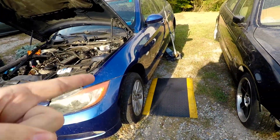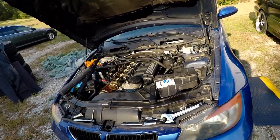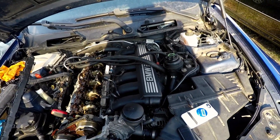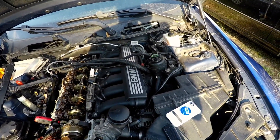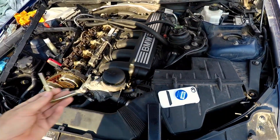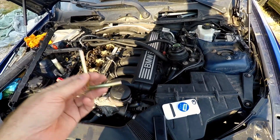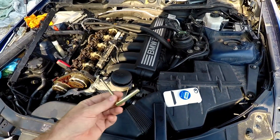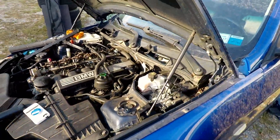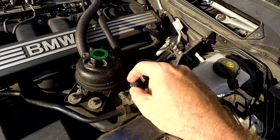We jacked up the car like everybody said to put the crank pin in — everybody's wrong, don't do that. On all-wheel drive cars the driveshaft's in the way, you can't do anything, and my hands are too big. There are two different crank pins. The black one with the chain on it from the last engine — that's the one that works for this engine. The other one is not the right size, that's for some other engine. We reached in right behind the power steering tank reservoir.